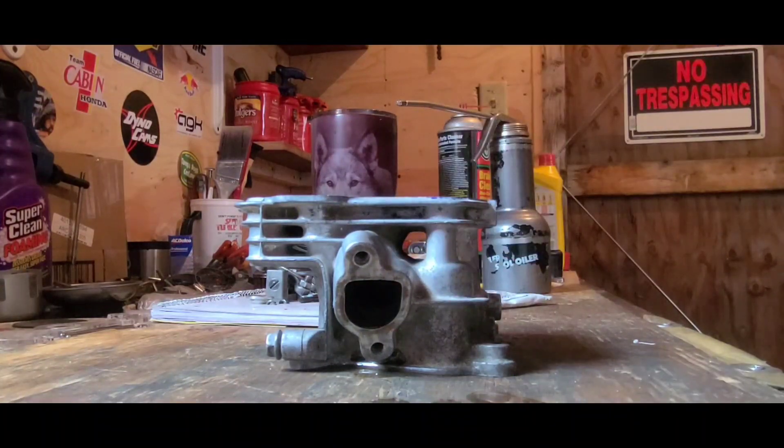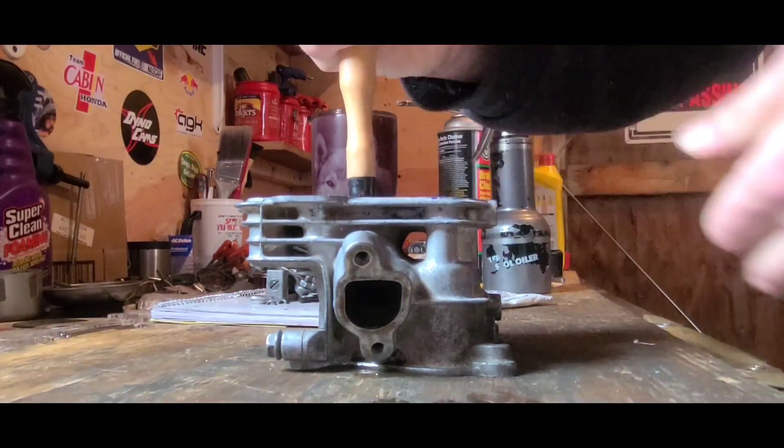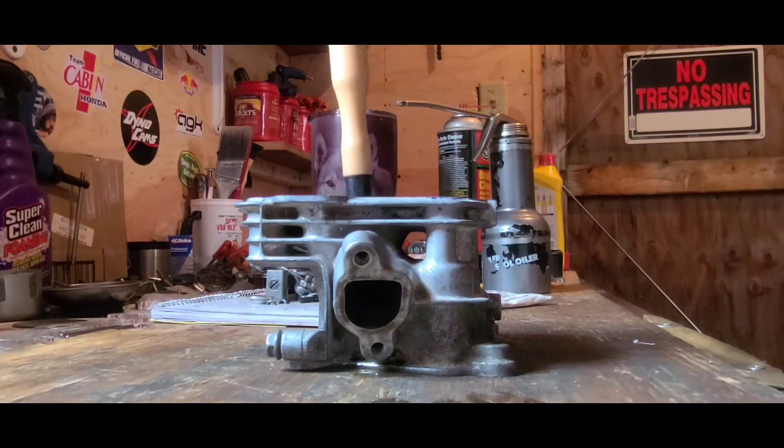I'm going to lick the suction cup, stick it down on top of my valve, and I'm going to twist back and forth — a little left, a little to the right. I'll lift it up, place it back down, and do it again. You hear it grinding? I'm just twisting until that grinding noise is just uniform and smooth — it just sounds like two surfaces rubbing together, not grinding. One more time: lift it up, place it down, lap it in.